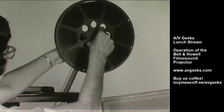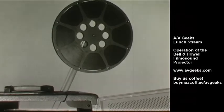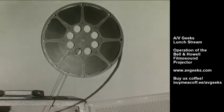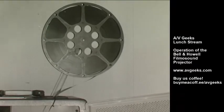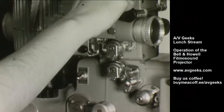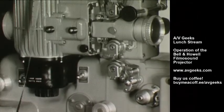Now, place a reel of film on the front reel arm and press it onto the spindle until it locks in position. Place a take-up reel on the rear arm spindle. To begin threading a film, first unwind about 4 feet of film. Slip it through the slot in the top of the projector case and pass it over the film roller. Then pass the film under the feed sprocket. The film will engage the sprocket teeth when the guard tab is pressed.